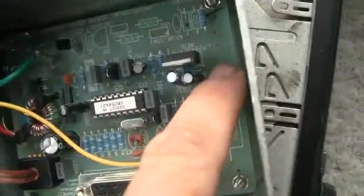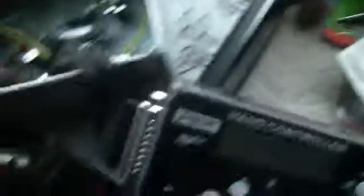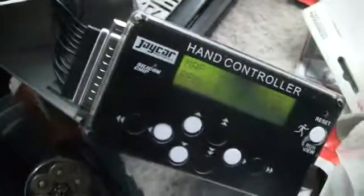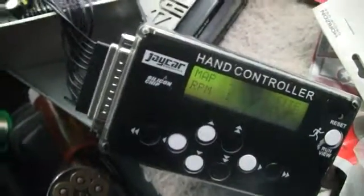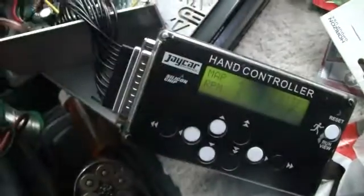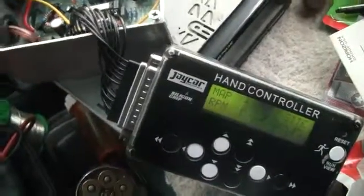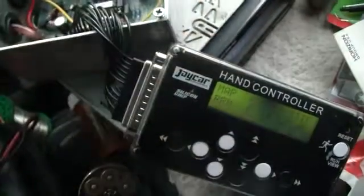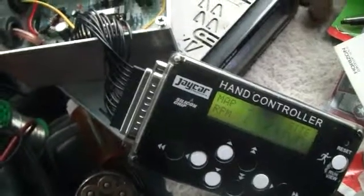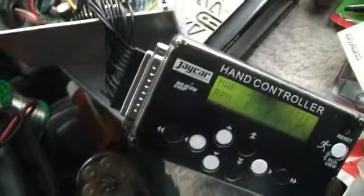I'm going to cut that resistor out - I stuck it on the bottom. I cut my resistor out, I had a resistor on the bottom. It feels like a very stiff wire now - doesn't feel like it's ready to break. Now let's see what happens. It's kicking - that means it's too advanced. I just inverted the input - see if that makes a difference. Oh, it's going to run now - advance it again a little bit. It's supposed to be right polarity because now it's tuned. Retarded a little bit - just a couple degrees at a time. It's fussy.